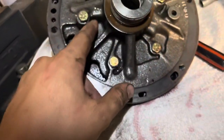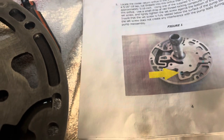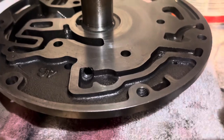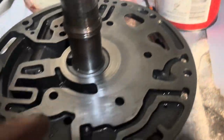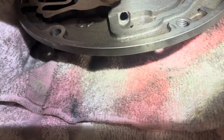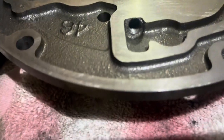I'm just gonna take it apart and do what the directions say. This is the first one — I know what it was, got a little bubble. This one: 5/16 by 18. Cut the threads in there, and then this is the one that's gonna be just to block off — got this one tapped. You can kinda see it. Put a little grease — not a lot — because I don't want a lot going through here. You can kinda feel the air coming out when you blow through it. It's no big deal if you get shavings in there — you put a tiny bit of grease, just enough to catch a lot of the shavings, so you won't have to deal with shavings in your pump.